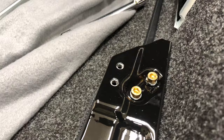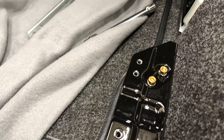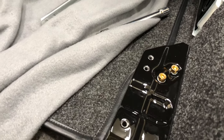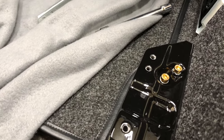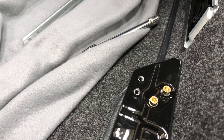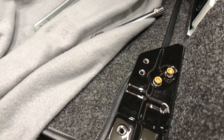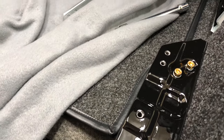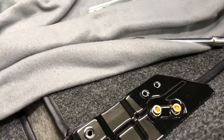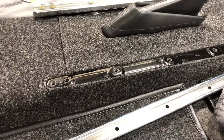For now we can just mount it in there slightly snug and that should be good. I've got it sitting in place — you can see the side-to-side action up front and also in the rear, plenty of adjustment there. What's going to happen is we'll mount our seat in place into the rails — the top ones will be tight so they won't move — then slightly snug this down to where it barely moves. Once we start sliding the seat front to back, that'll track it and straighten it out in line with the other tracks, then we can go ahead and tighten it down once we like everything.